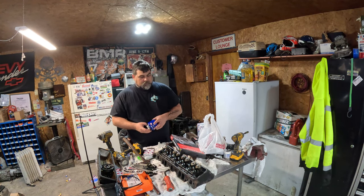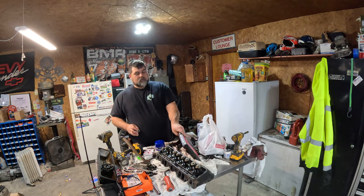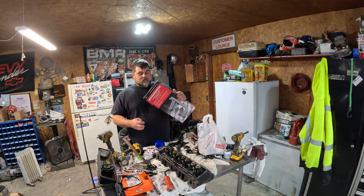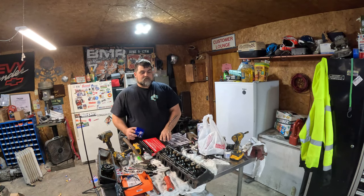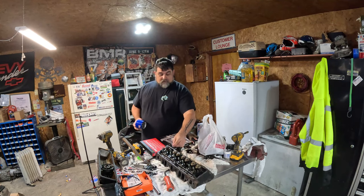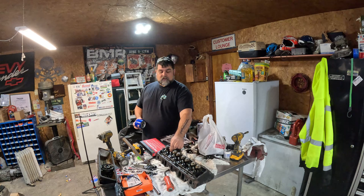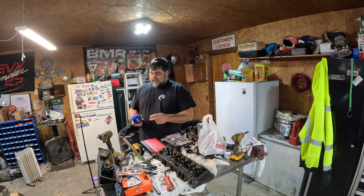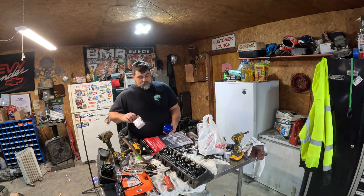But now I went to a big high dollar parts store and got me the valve compressor that I like when the heads are off. So let's see if I can go through and explain how I'm doing these valve seals and everything, and re-seating the valves, re-grinding the valves on the seat there. You mean lapping the valves, Tony. And make a little better video.